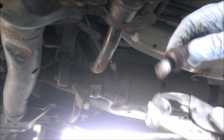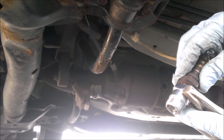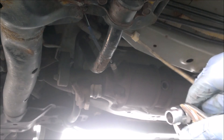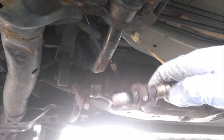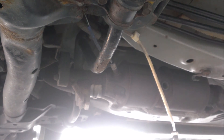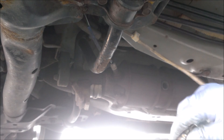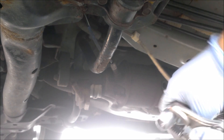I had to make the hole big enough for the little tip part here — now it threads in. First thing I'm going to do is put a little bit of anti-seize on here, as well as on this thread, just to keep it from seizing — because I did have to use a breaker bar to get this out. It doesn't need much, just a little tiny dab on each will be plenty. I'm just going to hand-tighten this in for now, and then once it's actually on the car I'll crank it in.